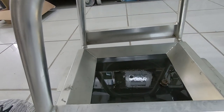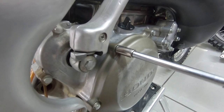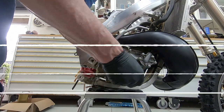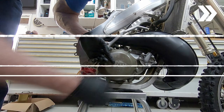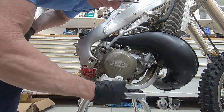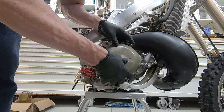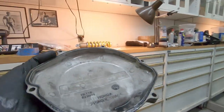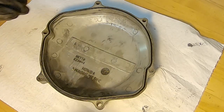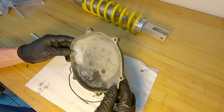The first thing you have to do is drain all the oil, which I'm doing now. Next we take off these fasteners, then take the o-ring off. I use a little screwdriver to pry up the o-ring. Now we just clean that up a little bit.